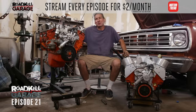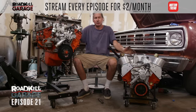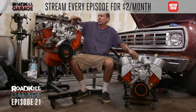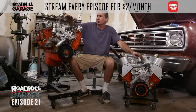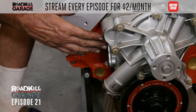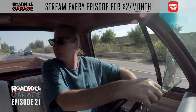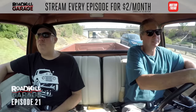Surrounded by small-block Mopars — here we have a Magnum and the old-school small-block LA engine. The Magnum replaced the LA series in the early '90s and there are differences that will trip you up when switching. Starting at the top: the Magnum intake manifold has vertical bolts while the LA has angled bolts — they don't interchange. The thermostat location is different too, which will affect your A/C bracketry. A Magnum from the factory has a different front cover; I've replaced it with the LA cover to give me a provision for a mechanical fuel pump, which I prefer over electric.